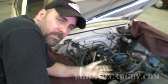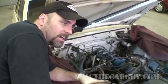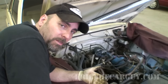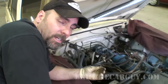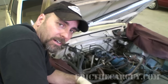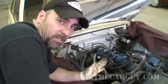Next it's time to actually remove the carburetor from the engine. This can be sort of a mixed bag — some are relatively easy and some more difficult. Some will have many vacuum lines, some not so much. I find that if you just let the vacuum line lay where it was hooked up, you can often identify where it goes. If not, use masking tape or label makers to mark the vacuum line and the port. Some vehicles have a vacuum diagram on the under-hood sticker, or you can use a service manual.